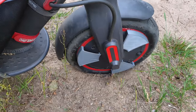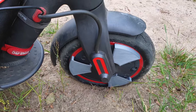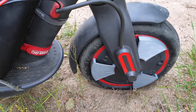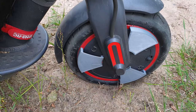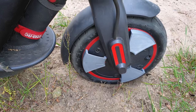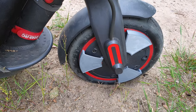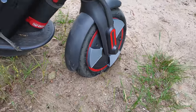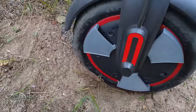I always wanted to build something like this. The first time I received a simple M365 and modded the firmware, I noticed that the motor was so hot I could barely touch it. But in the pro version, if you increase the power a little bit and increase the top speed, then the motor could really fry. Last time when I did some ride the motor was over 65 degrees — so way too hot. And I hope that thanks to this adapter the motor will survive much longer, especially if you've got modded firmware.